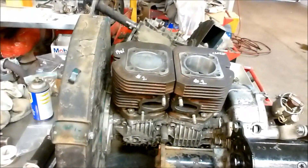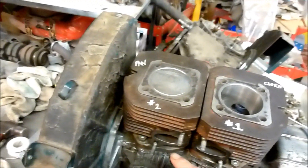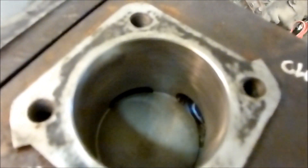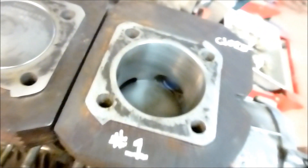These are the cylinder base gaskets — they go right between the block and the barrels. What I'm going to do is stack those and get 60 thousandths, basically raising the barrel 60 thousandths up off the block. That will lower my compression, but it will improve my port flow. The piston actually occludes the transfers and the exhaust ports, so it'll make it more of a high RPM motor. Then I can mill my heads accordingly.